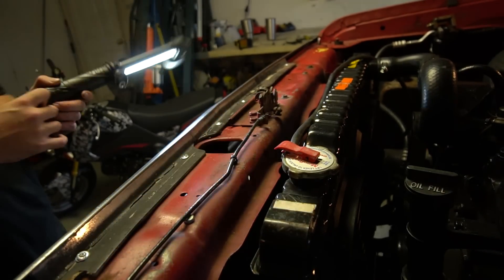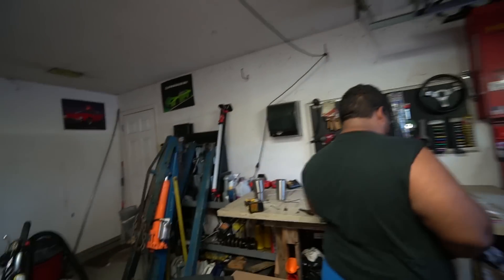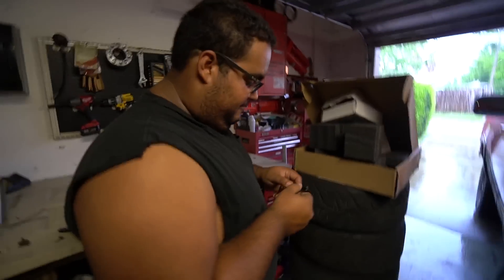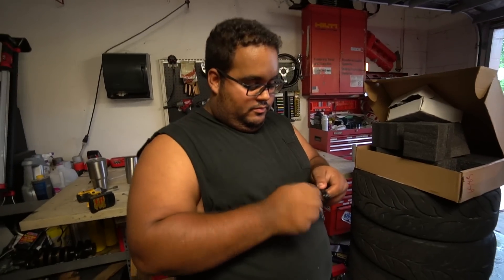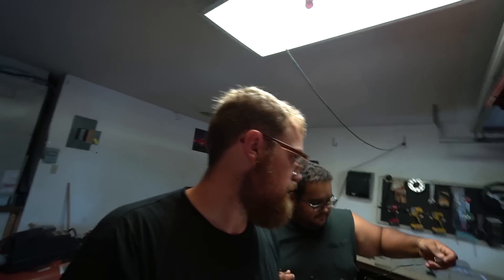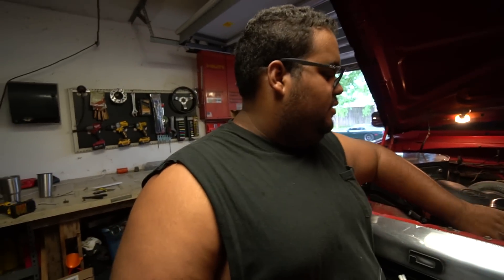Hashtag clean fan install — hotboy but still cool, because it's a radiator fan. Now all we've got to do is figure out how to wire this thing up, which should be easy. The only difficult thing will be finding a place to put the probe. It's a really good radiator push probe — you just push it into the radiator fin, so it's cake, it's actually really easy. This is a downflow radiator so I want it in this area.